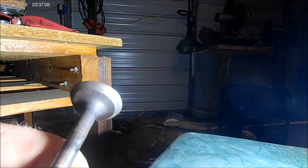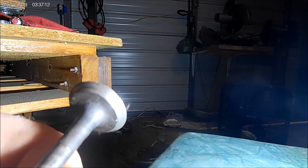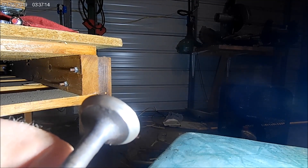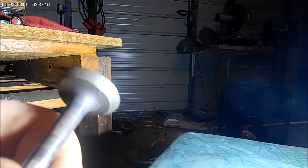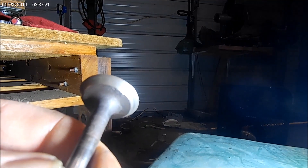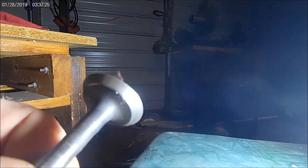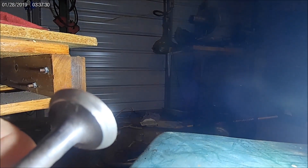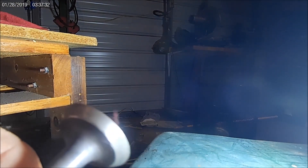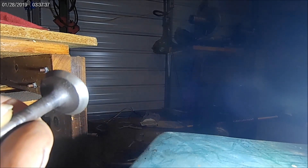I mentioned a lot of the comments that people made — I replied to some of them — until I found this valve, the exhaust valve, and it had a big burn spot on it. I tried to run that on the grinder with my drill, and that'd be fine, except when it's got that little caved-in spot there. When you do that, it's almost impossible to keep it moving in and out. If I had some way of keeping it secured, it'd be all right.